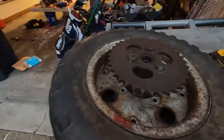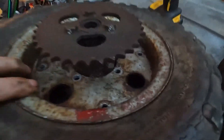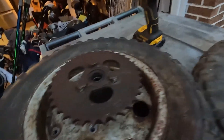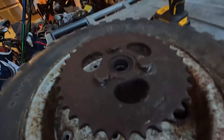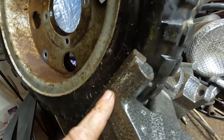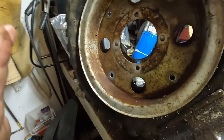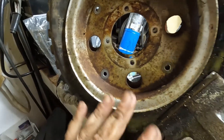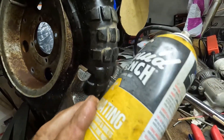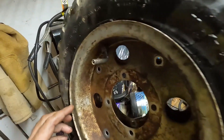This was a disaster trying to get this apart — someone welded these on. I don't know if that's factory; I doubt it. I can't separate the two until I can get that off, get the sprocket off, and then the hub through. So this is going to complicate things. I like to get it in the vise, in between, just under the rim. I screwed these rims up a little bit on my old one because I was prying too hard, so I was just letting the vise do the work, going all the way around.